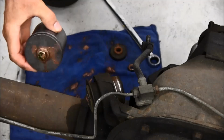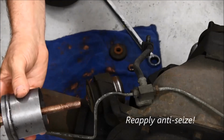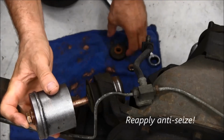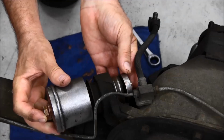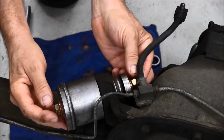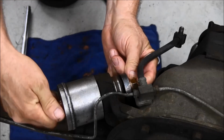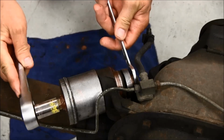Moving to the driver's side bushing, be sure to reapply anti-seize to all of the washers before placing the bolt, washers, and removal cup in place. Put the small flat disc with 3 recoated washers onto the bolt, followed by the nut. Start tightening the nut and bolt.